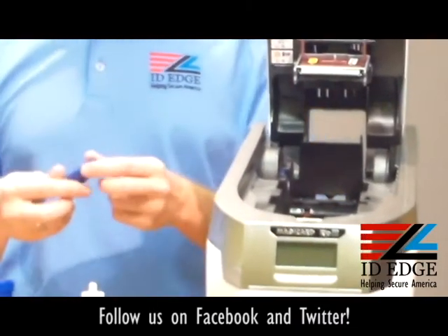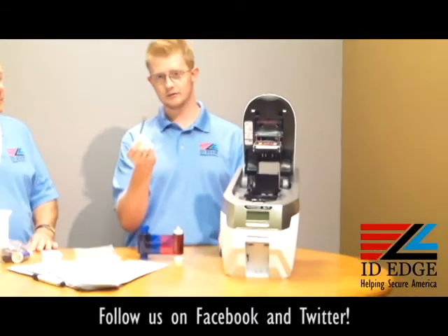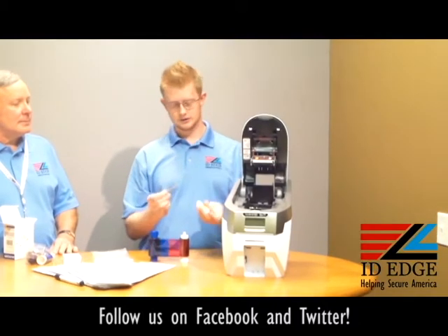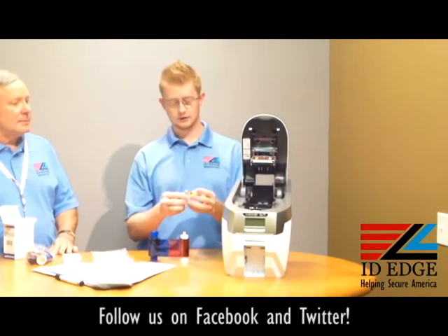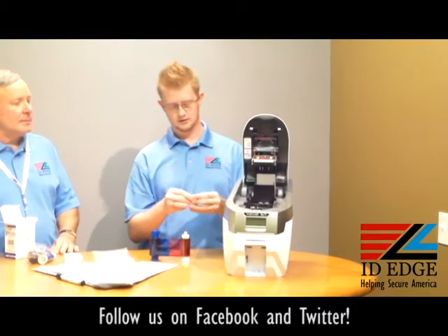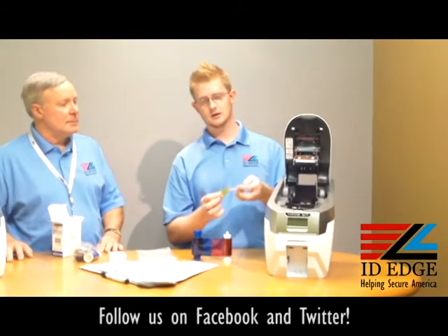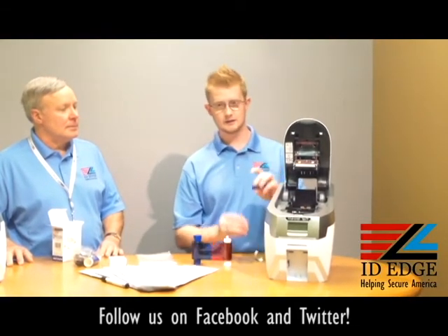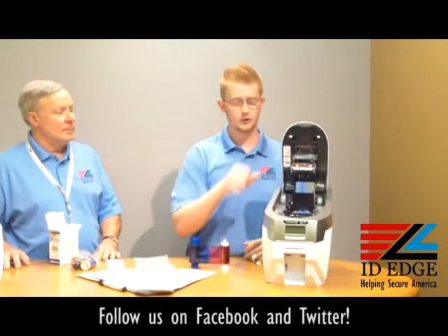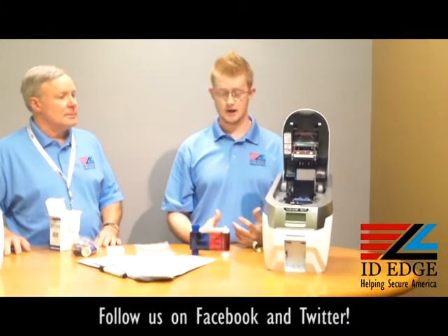The cleaning roller is going to be replaced — that's this blue roller right here. What you need to remember is you can pull this little silver spindle out. Never throw this away. You can discard the roller. Now just slip that silver spindle in, pull on the yellow tab, and this will peel away and expose the adhesive. Insert that back right over the orange roller and your cleaning roller is nice and new.